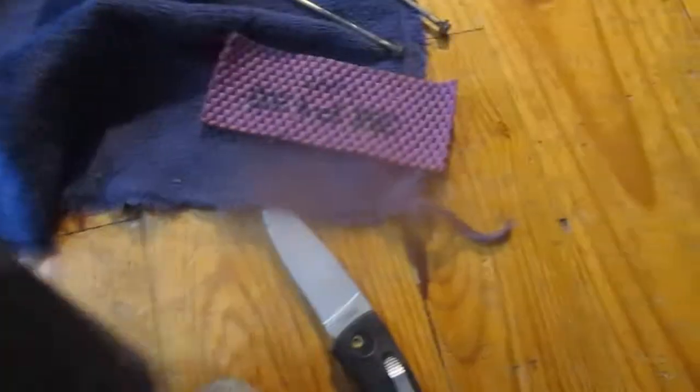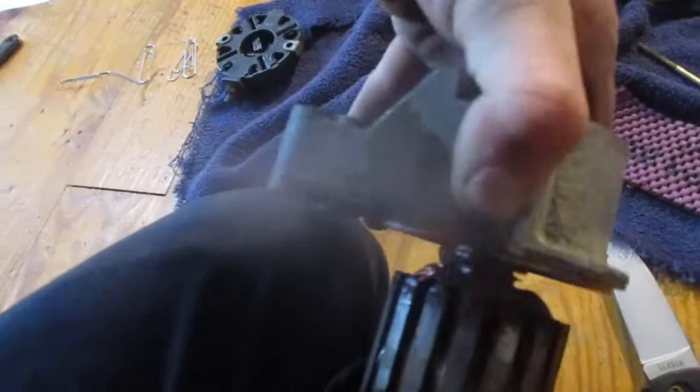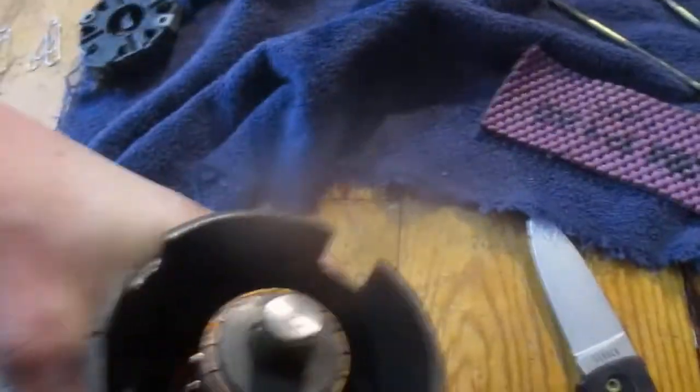It's got a lot of hard magnetic pressure, so just so you know, once you get that brush holder area empty there, you might still think you've got something holding it, but you just gotta pull hard, because there's such strong magnets trying to hold it in. Okay, get that close enough lined up. There we go. If you get it close lined up, it'll go together once you put the bolts in. Now I got to do this.